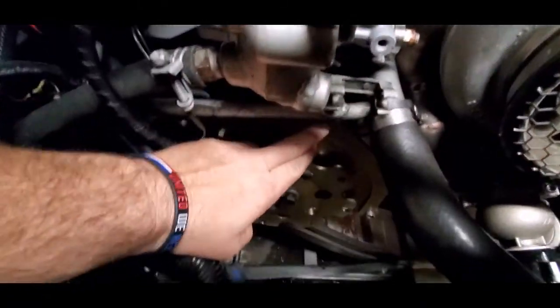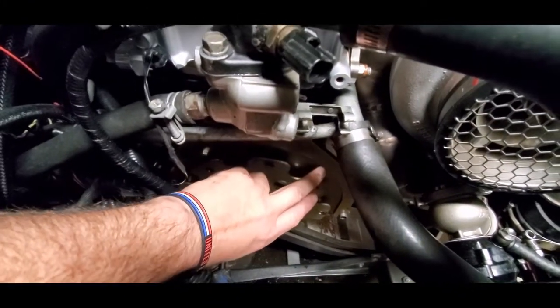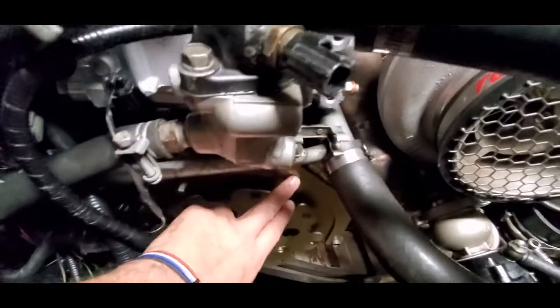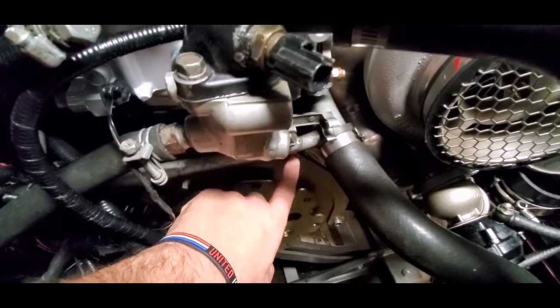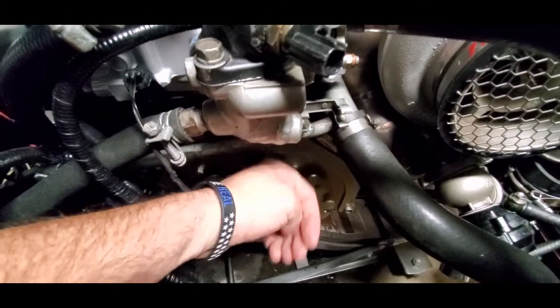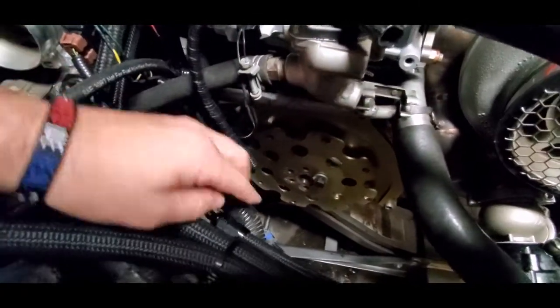Being that I'm going with the six-bolt, I had to get this Kegley kit. It's got this little spacer here — going across from one side to the other is about three-quarters of an inch. That causes some problems because you're spacing it out further, pushing the transmission towards the passenger side of the car.